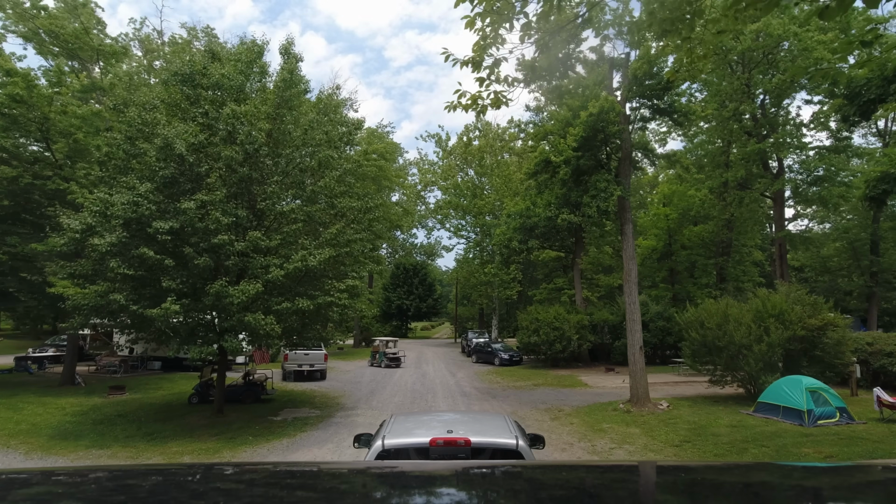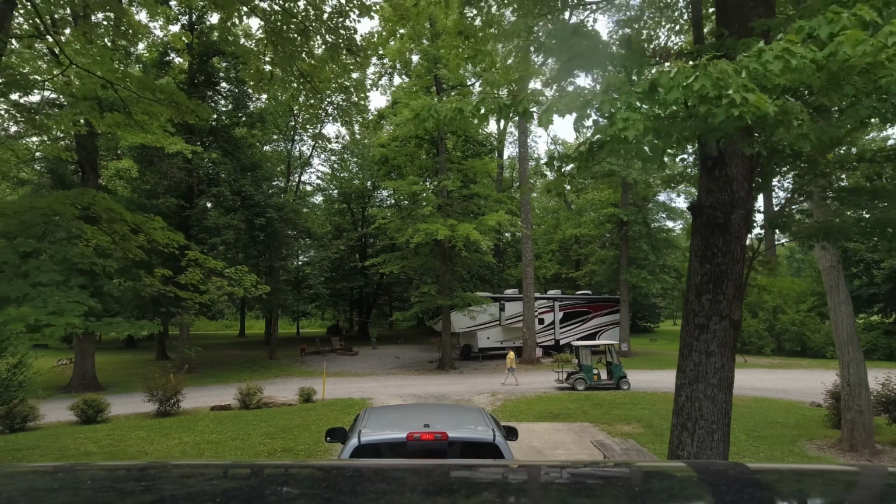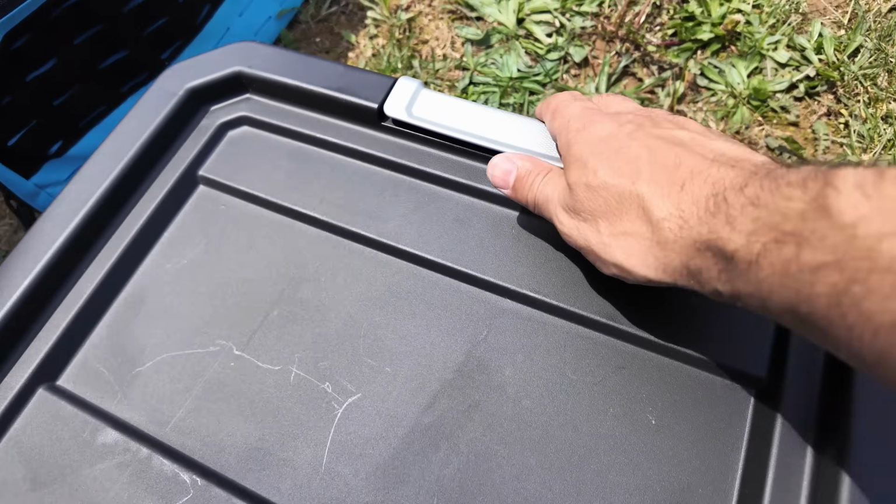Plenty of things can go wrong from the time that you booked your 50 amp site till the time you actually arrive. If you're stopping at some random campground at night to rest, they might not have a site available with your power service. There's a few situations where having a dog bone's going to come in handy, and having a little power is better than none.